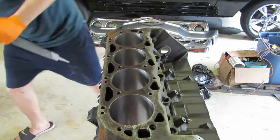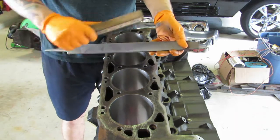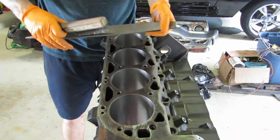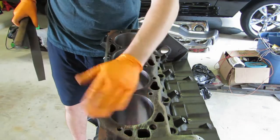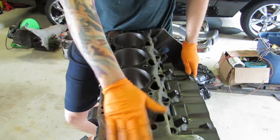In between passes, take a wire brush and brush out your file in both directions. I tried using some baby powder — they say that helps to keep from gumming up your file. Clean with lacquer thinner before you even start.